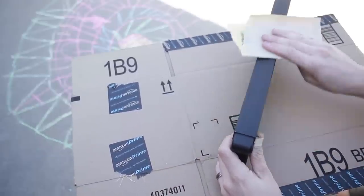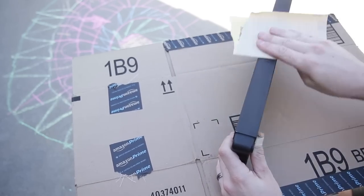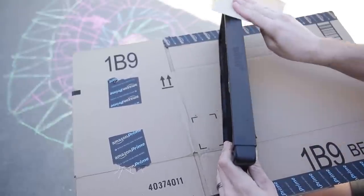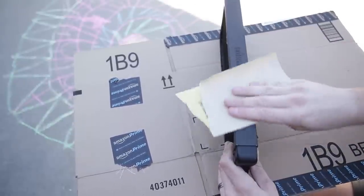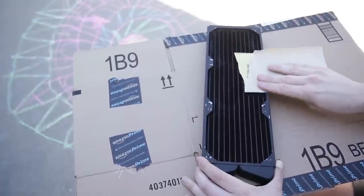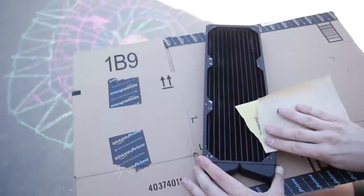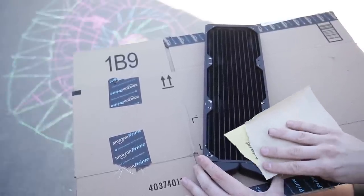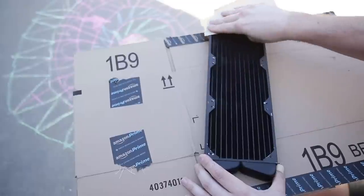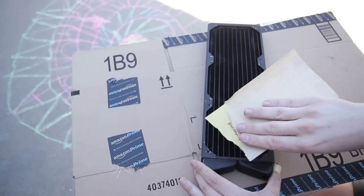This is a how-to paint your radiator tutorial. Go ahead and take your 400-grit sandpaper and make smooth back and forth motions — just like waxing a car. Pay special attention to areas where the paint or powder coating is starting to chip off and make those as smooth as possible. You're roughing up the surface texture and removing any dirt or grime stuck to it.